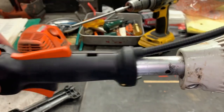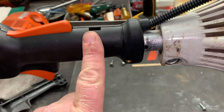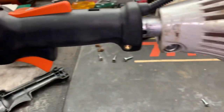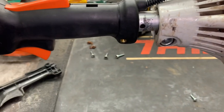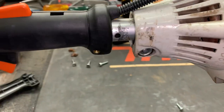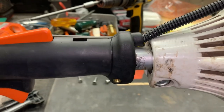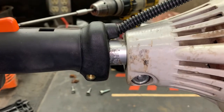Give your trimmer a good cleaning — blow all the dust and grass out. For throttle control spacing between the power head and the throttle control, the rule of thumb from Stihl school is basically a finger's width. I always like to just cover up that hole on the shaft. You don't want to kink the throttle cable — don't cram it back so hard that it kinks. Right about there is good; a little forward would be even better. Just cover that hole and you're good to go.